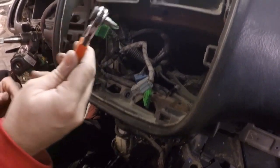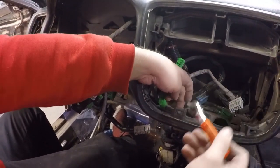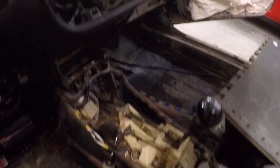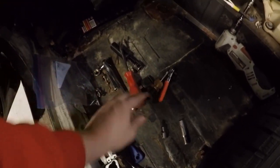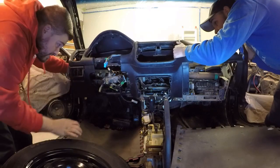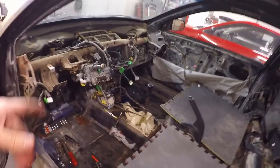A quick tip for these areas: you're going to need something like a smaller screwdriver to get in there because they're in such weird positions. Get the wiring harness out of the way and you should be able to reach the back side. Managed to get those screws out — they are a pain in the butt — using a stubby screwdriver to get behind there. The dash looks loose, so we'll set the camera up and get this thing out. Finally managed to get the dash out — the only thing that hung it up was one tab down below with a screw still in place. Once we got that loose, everything popped out.